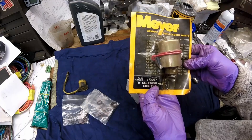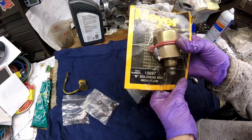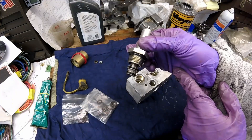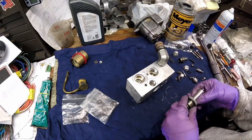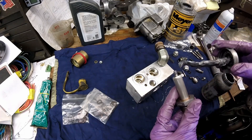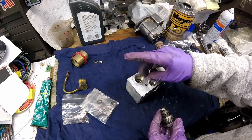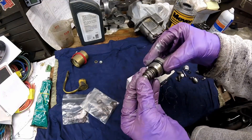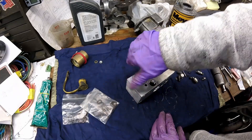Next I'm going to install my B-solenoid, and that goes here. The part number for that is 15697. The B-solenoid has three O-rings. The studs have a tendency to break after they get rusted, so I always like to put a little never-seize on them up here. This solenoid gets this bigger, thin spring — it goes in first. It gets this check ball; you can see it sits up in here perfectly. That goes in next, and then you just screw it in.